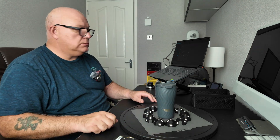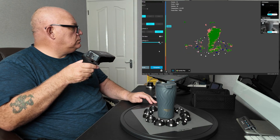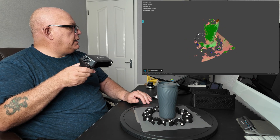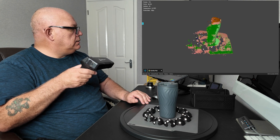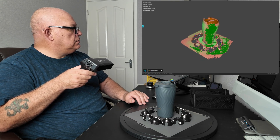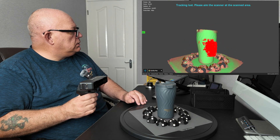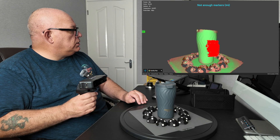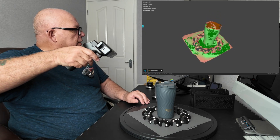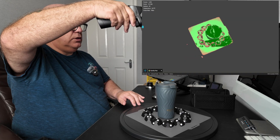Place the coffee cup in the middle of the dots, hit Preview, and there we go. Now I've just got to make sure that I keep the dots in frame as well as the object to be scanned — the dots are being used to track and the coffee cup is being scanned. Keeping them in frame — if I point upwards, you see, none of the dots are in frame, so there's not enough markers; it needs four. Come down and there they are in frame now. Obviously to get the top in, I need to come up at a steep angle — coming right to the top now, still got the dots in underneath.